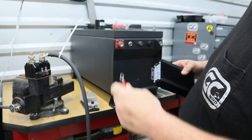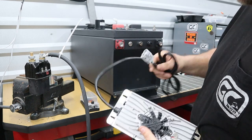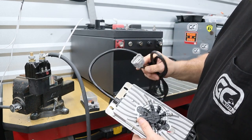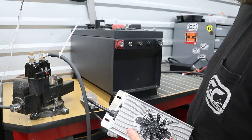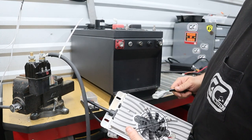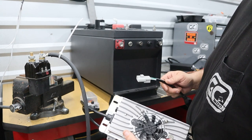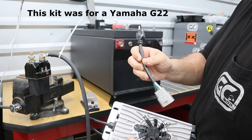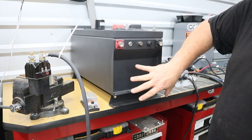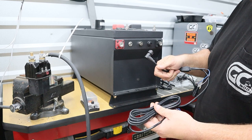Going back to the charger: ECO battery has given you a new weather pack connection. Certain carts will have certain outlets for it — Club Car or EZ-GO have a body-mounted plug, but on a Yamaha they don't have it out yet, so they send you a regular 110 plug. Other than hooking that up, the only thing left is your new wiring harness for your meter.